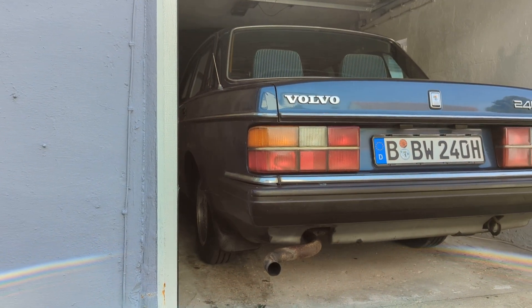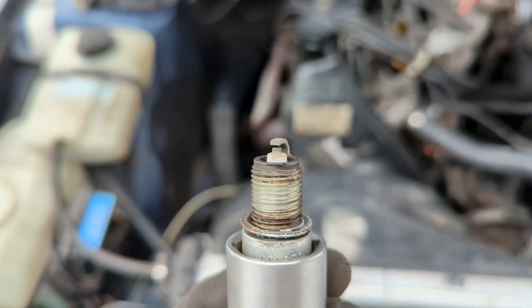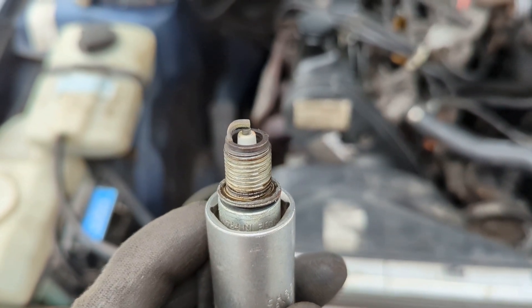I've gone out for a drive — she does pull very well, possibly even better than before, certainly no worse. She runs great, doesn't seem to be running rich; there's no fuel smell or smoke coming out of the tailpipe and the spark plugs look good. I need to keep an eye on fuel consumption to make sure it's not using too much. I should probably get a Gunson Colortune to check the mixture properly, but I'll monitor it through gas mileage and spark plugs over time. It's certainly not running excessively rich, so it's okay — we'll see how she does long term.